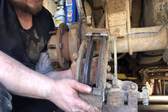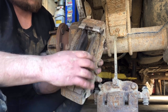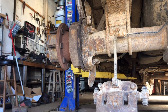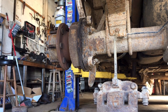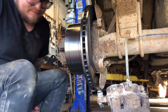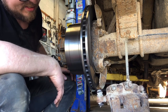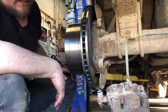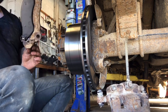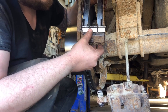We're going to assemble the brakes with the new pads like this — because if you put the mounting bracket on first, it's almost impossible to feed the front pad into place. So we're going to put the pads on before we put the bracket on. Let me get this cleaned up and I'll be right back. Alright guys — I cleaned off those sliders, greased them up, cleaned off my caliper, gave it another wire brushing, and used the Dremel to clean off the rust on those ears. Got the rest of the mud out. Pay attention to how the hardware comes off — that'll help you put it back correctly.